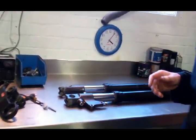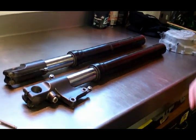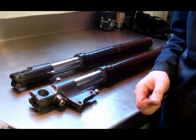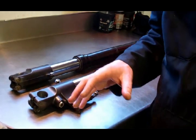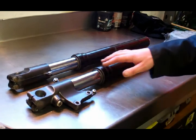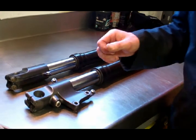The forks themselves also need a bit of work. At the moment these are standard Aprilia forks — they don't look much like the RC45 forks, which is where we have to do a bit of magic. The fork bottoms need treatment to make them look like magnesium, which involves jet blasting and using special dyes and lacquers. The stanchions I will have to have nitride plated to give them that works factory look, and the fork tubes themselves I'm going to do a special trick with to make them look like they've been anodized in a sort of bronze-gold color.